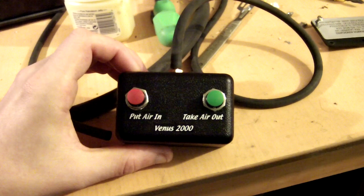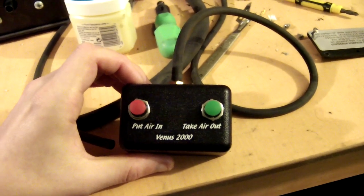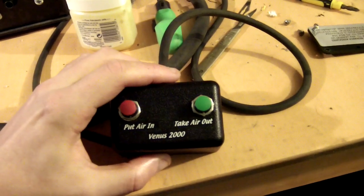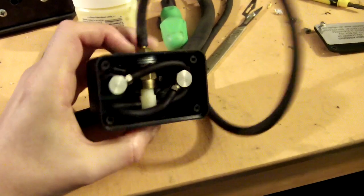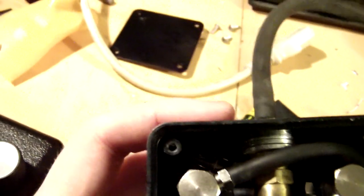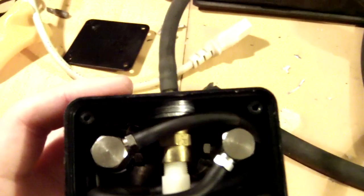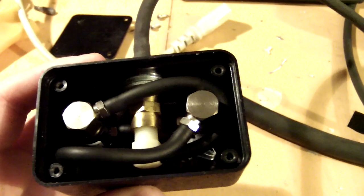Note: this is the only place where the logo is visible, and according to their website this is deliberate. People might want this to not be obviously a sex toy, so they don't stick their logo everywhere and the mysterious black box is actually designed to be a mysterious black box. Down the bottom there, one in that corner, one in that corner — those are one-way valves in different directions. Tube comes in, T-piece, one branch to each of the push buttons which open when pressed, and from there each one goes to valves — fairly simple design.